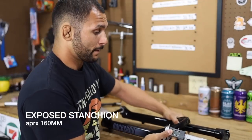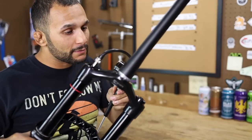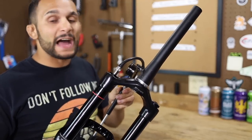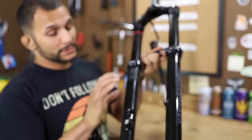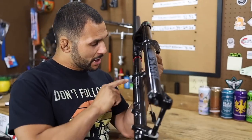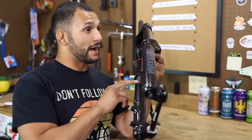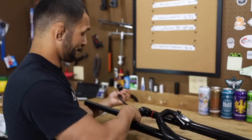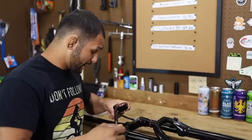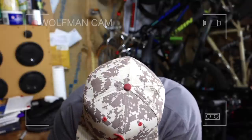Although, we don't know the pressure yet. It could need more pressure, and it might stretch. All right, let's check the air. It shipped right at 65, right? It was 65. That's low, huh? Yeah, it's pretty low, so we actually might get more. Is there a chart on this? Yeah, it does have a chart. What's it say? Riders 140 to 160 pounds is 75 to 85. Now, with 160 millimeters of travel, I think we should go to 75. We do run the Trace at 77. Let's go to 75. All right, we'll try 75. But it came with 65? Okay, it came with 65.